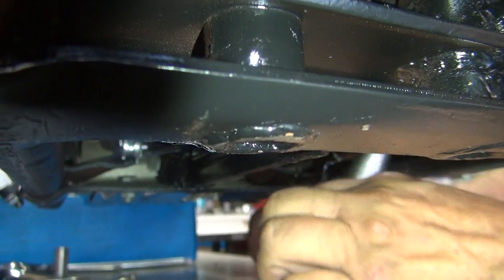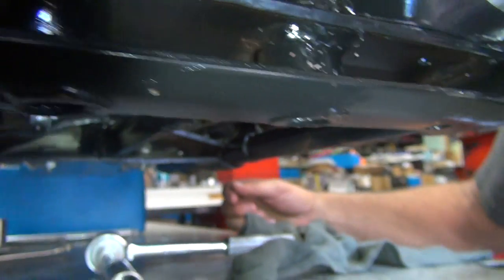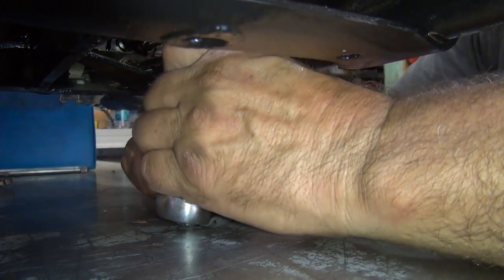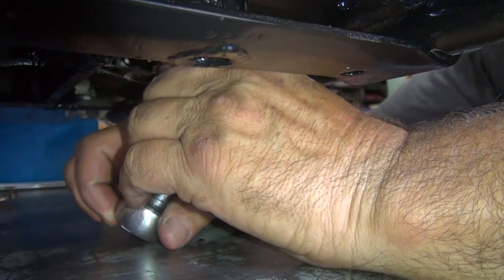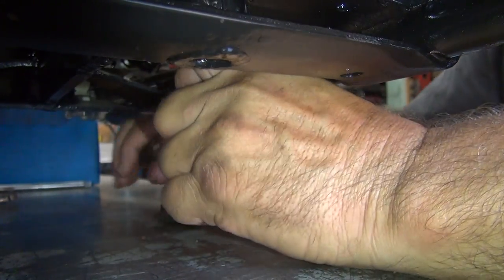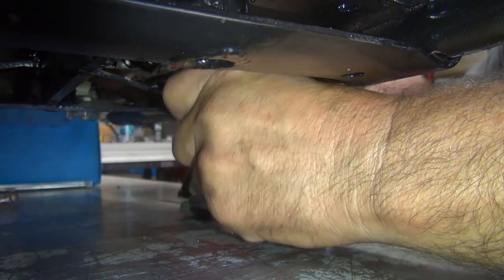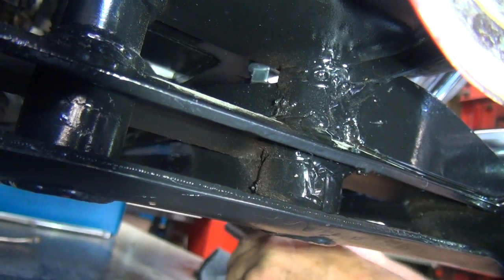I didn't even touch it — I saw you move the tranny. I said a quarter turn, I heard a bunch of clicking, that's more than a quarter turn. The tranny has to be pulled flat down so we know where the tranny's at. You have all the nuts just close to the frame but nothing's moving. Is that too long for you? Yes. Okay, take it off. I have a shorter one if you need one in between. I got it. Tight. One quarter loose. That's it — perfect. Good job.